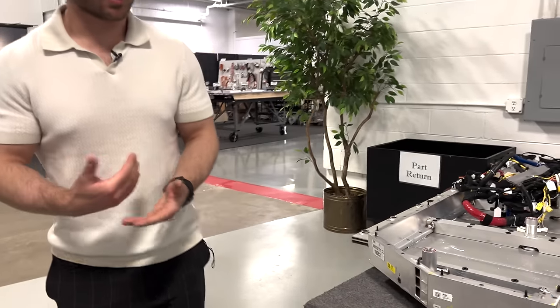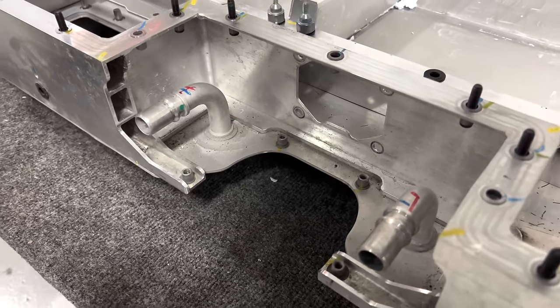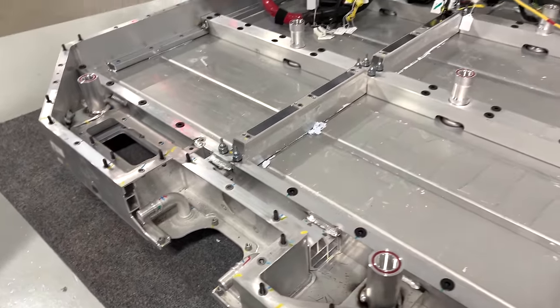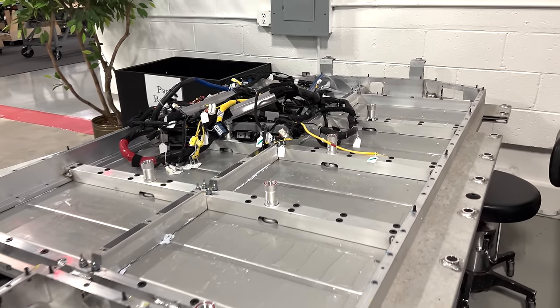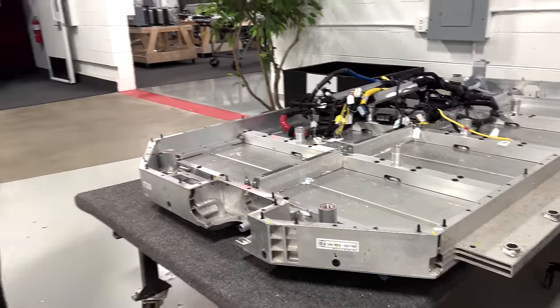Did we want to talk about the battery tray at all? Yeah, I think very briefly, part of the glycol loop, and something that we'll touch on when I believe Antonio and I will be doing the battery video itself, but a bit of a sneak peek is the integrated heat exchanging plate that is actually integral to the structure of the battery pack itself. So, in terms of an overall thermal management system, when we consider what's inside the pack, you can see there's no need for any nylon lines, and that eliminates leak paths inside the battery. So we'll go into more detail on that when we do a full breakdown of the battery. But yeah, thank you. That is just another aspect of this system where the battery is relatively easy to interface with the thermal management system. Yeah. So outside of that, I think we've just about covered everything.